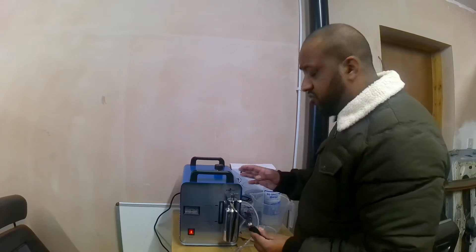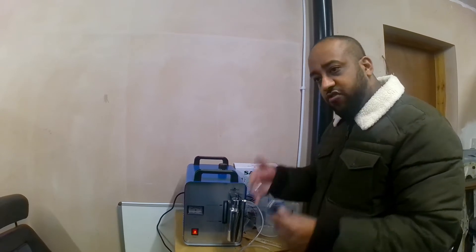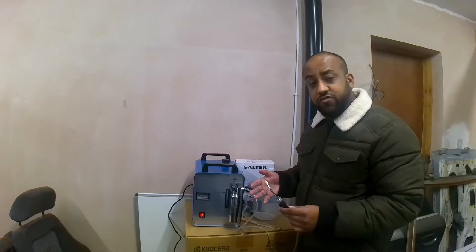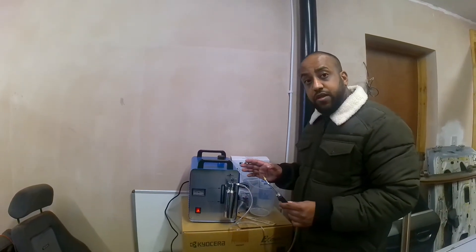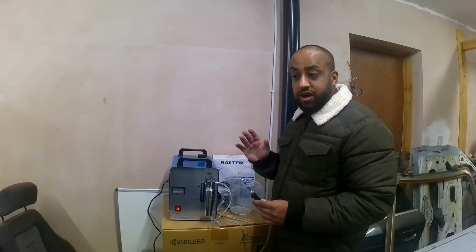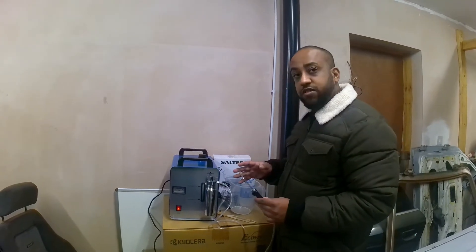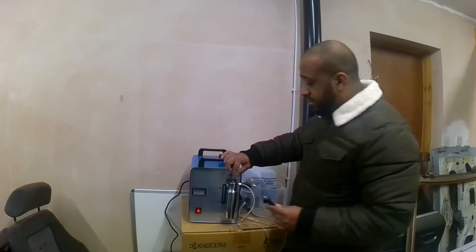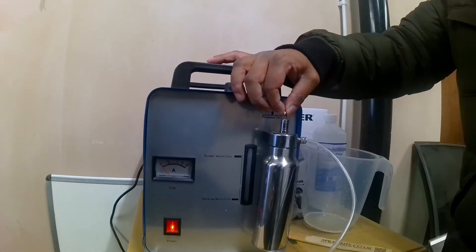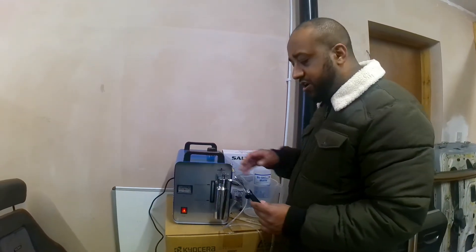Once it goes off, I'm going to show you guys that there's enough pressure there and then what the theory is behind it — how we actually inject this in the car as well. It will work for normal cars and direct injection as well. It is different to Terraclean. Terraclean works on the fuel system. This works where the air is actually injected, not on the fuel system — so they're very different in how they go about doing their job. You can see the machine switch off now. If I pull this up, you're going to hear the gas coming out. You can see there's quite a lot of pressure there. As the pressure drops, it will continue replenishing that gas.